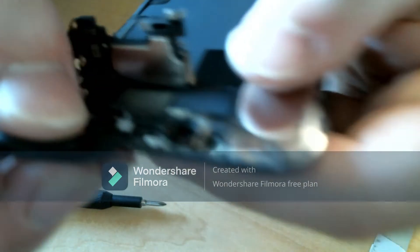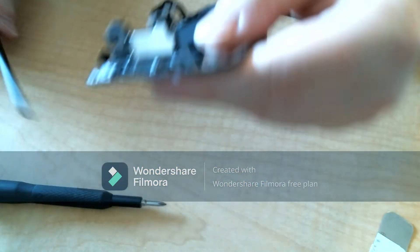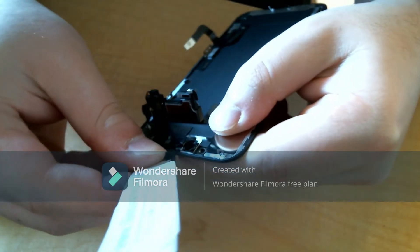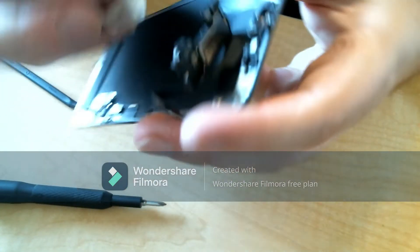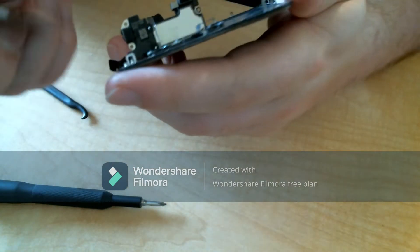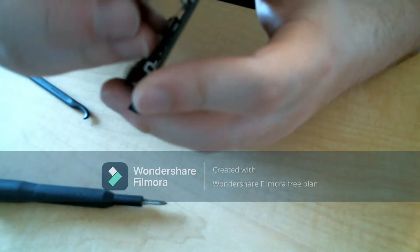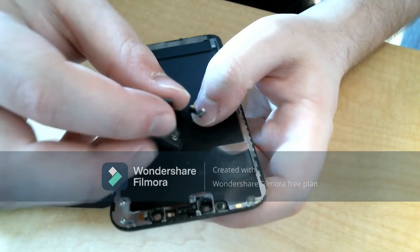Use this little tool to slide off the upper part of the display. I'm using a hard plastic tool just because I couldn't get it quite underneath — you just slide it right underneath there, use it to pry that up a little bit, then pry underneath the little gold part, be nice and gentle, get that off, and then use it to get that last part off as well. They all come out pretty easily — nothing too hard here.